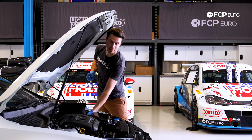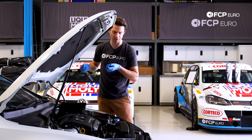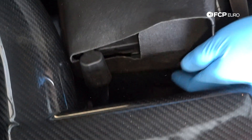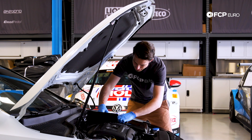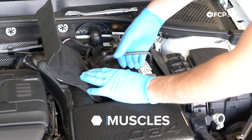There's one pinch bolt that sits right in front of the battery and it actually pushes down on the footing of the battery — this is where I assume the battery is actually broken. We're going to loosen that up and then we're going to be able to pull the battery out. This is a 13-millimeter bolt that is driven into the battery tray itself, and there's going to be a sheet metal foot that pulls the battery down. Here's the bolt, and this is the footing — it seems a little stuck right now because of all the acid around it. We're going to take these both out. So the next step, we're going to pull this battery out. Remember this thing weighs about 30 pounds, so it's a little bit heavy. We're going to grab the battery by the handle that's built in and pull it up and out of the car — just like that.